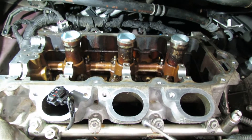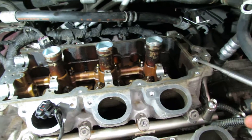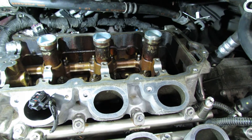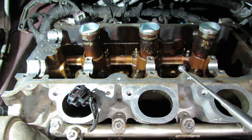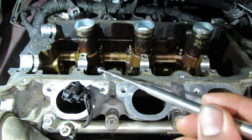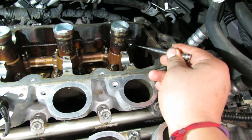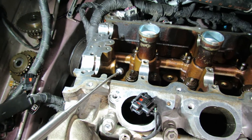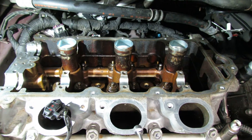So the sequence for this one goes: the bolts are positioned here, over there, here, over there, here, over there, and here, over there. The 13mm will be torqued after you're done with the main ones. Starting from the first bolt, you go 22 foot-pounds, jump down to 22 foot-pounds, then 22 foot-pounds here, back here, back up there, then here, over here, back down there, jump over here — 22 foot-pounds each. That's the full sequence and torque spec of 22 foot-pounds for the first pass.